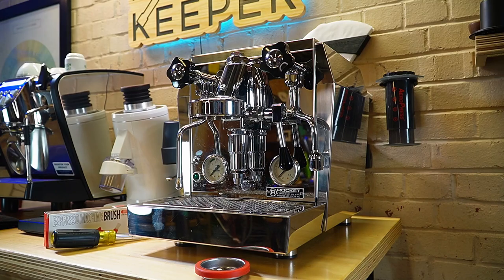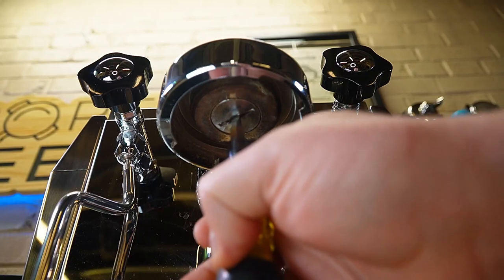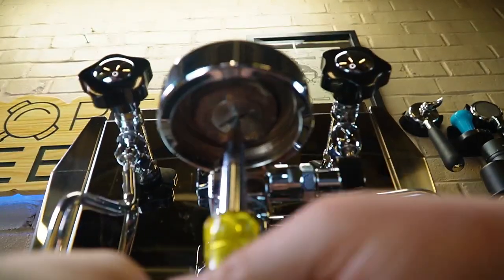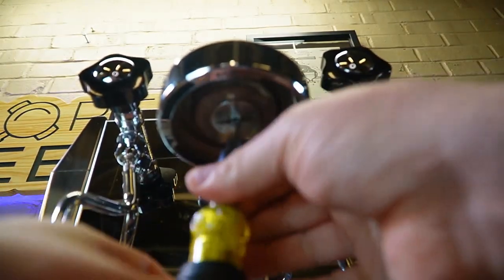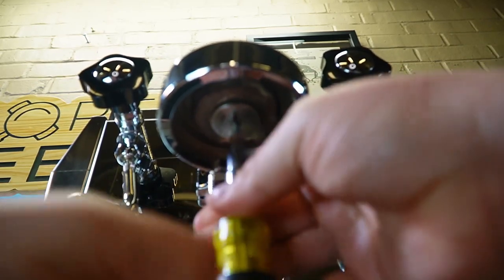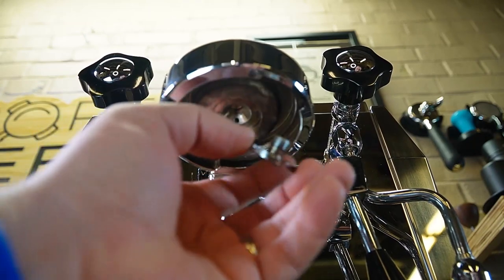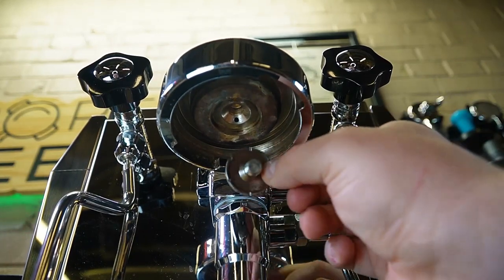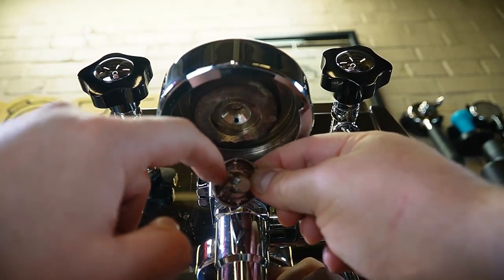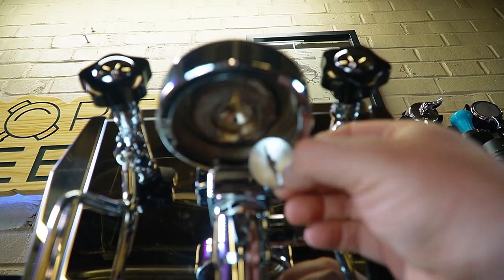Let's get the bottom taken off. You may need to remove your drip tray to fit a screwdriver up under it — the wider the screwdriver, the better. Sometimes you need the machine to be heated up, but just unscrew this distribution shower head. It's really not that dirty, but what will happen is these little grooves on the side will get full of oils and then your water will want to come out one side and not the other, leading to an uneven extraction.